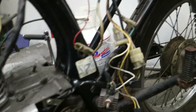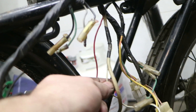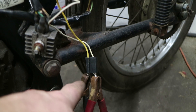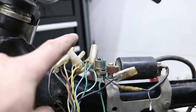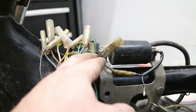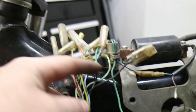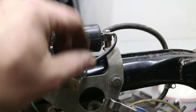Figured out a few things. I was right that this weird plug is indeed the battery positive and negative. The yellow coils into the factory green, which is the ground; the white connects up here. Somebody changed this around a while ago because it's not factory colors. I just put a couple of little connectors in there and I have it running off a six-volt charger. I was right also on this other connector — it comes from the headlight wiring, which is basically the kill switch. It takes the voltage through the kill switch and sends a positive six volts to the coil. Because I don't have the headlight connected, I'm just going to plug the six-volt positive straight into the coil, and that should give me enough to get a spark.